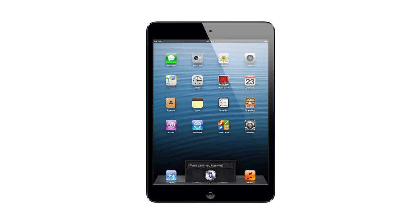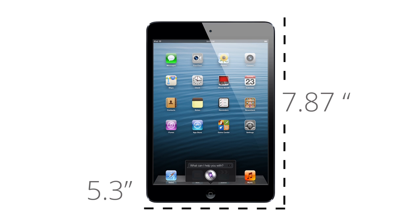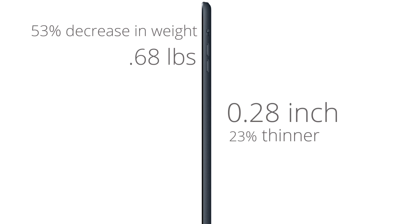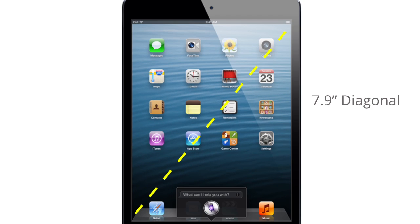Which means that you are among the very first people on Earth to see what's inside it. Small enough to hold in one hand and a good deal lighter than the original iPad, the iPad Mini comes in at 7.87 inches tall and 5.3 inches wide, shaving off almost 2 inches of height and width. With a 23% decrease in thickness and a whopping 53% decrease in weight, this latest iPad is only a few ounces heavier than Amazon's new Kindle Paperwhite. The screen itself is a 7.9-inch diagonal LED backlit screen with the same resolution as the iPad 2, 1024x768 — obviously not a retina display.